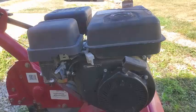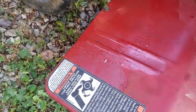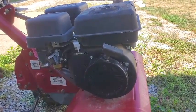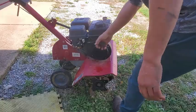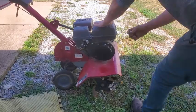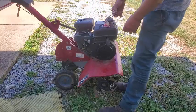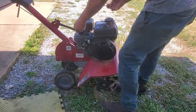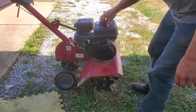Get this back on. It looks like there might have been a little water in it. Got a little evidence of some water droplets on there - so there was some water in there too. What was in there is probably out now. Settles to the lowest spot. No primer, just the choke. I'm kind of doing this on the fly. I don't have any carburetor cleaner or spray, so I'm going to soak this up and get some gas and wipe down in there. Let's see what kind of response we can get on this.